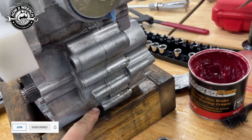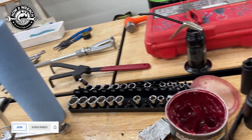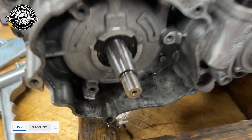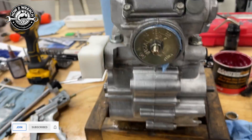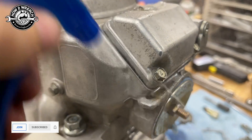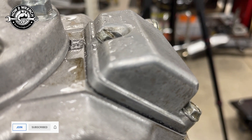I'm trying to do this one-handed so I don't have a lot of editing. Looking for any bubbles — if I had anything, that would be my problem. Let's see how that exhaust is doing now — I really cranked down on that. I think I was getting a really small leak out of there. The one place I did find a leak was in this three-bolt cover, where it's hard to seal up, and I saw a little bubbling there.